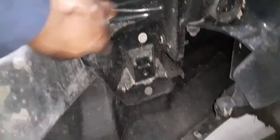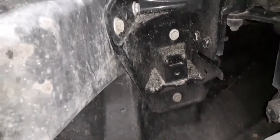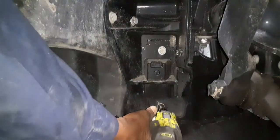One, two, three, and four — see them? You remove those on each side of the unit and the bumper comes out. This little skinny tab thingy is what mounts the bumper. Once you remove the bolt, this comes in and secures it — it hooks on there. Same thing on the right side: bolt number one, two, three, and four. These particular bolts are five-eighths.